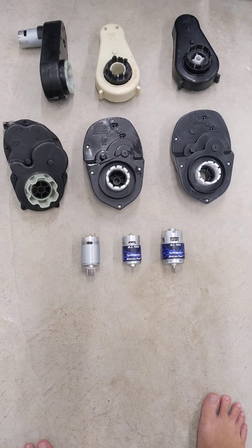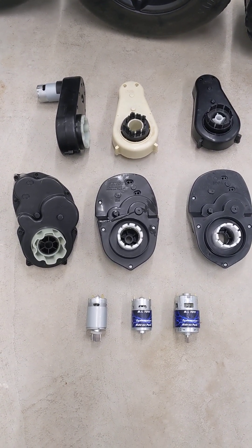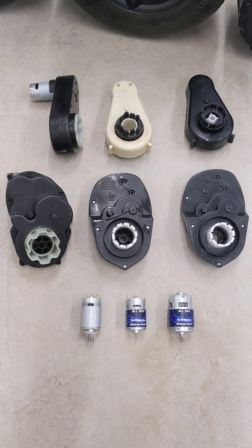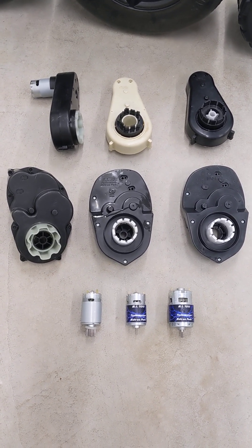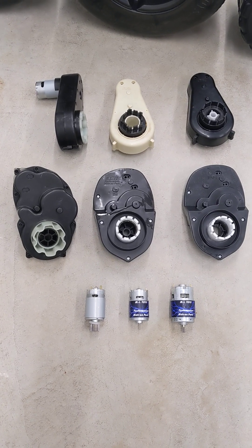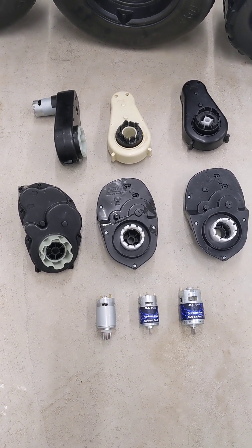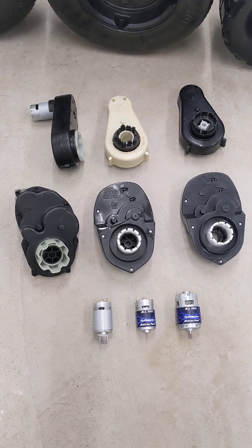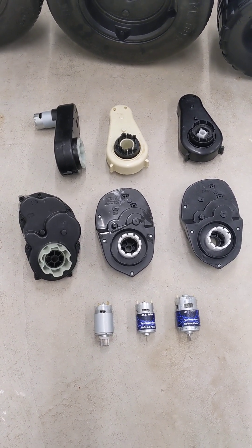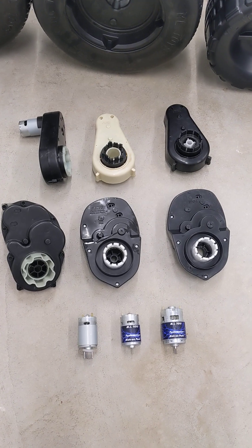When I talk about having it set up properly — the motors and gearboxes will take the abuse if you set up your car wrong. Meaning, if you have the wrong battery in, whether it's a lithium battery the car isn't set up properly for, or you've modified your tires, it's the gearbox and motor that take the abuse. A lot of people want to blame the motor and gearbox when the reality is it's because they put rubber on their tires or the wrong batteries in the car. More powerful does not mean more durable — quite the opposite. An NHRA drag racer, they rebuild them every quarter mile. If you want more power, please make sure you have your motors and gears set properly to the batteries and other modifications in the car.